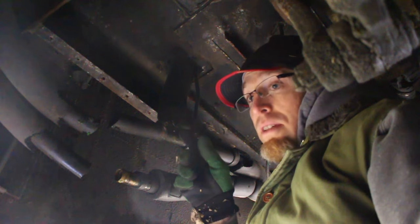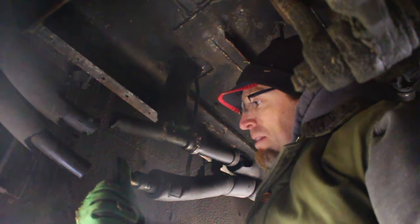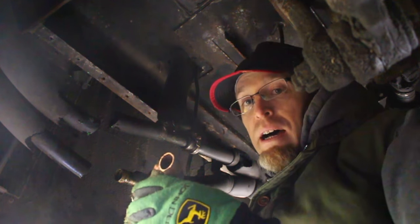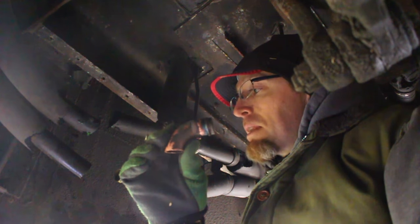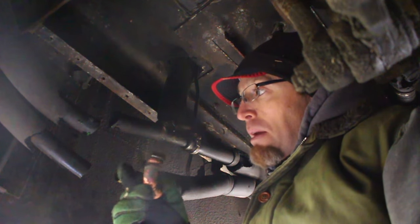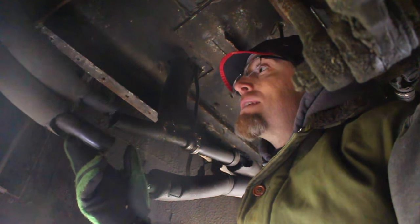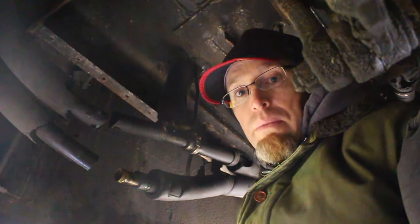This line comes from the engine, goes up to the defrost heaters, and then comes out this way. I've cut it, and this goes back to the engine. As you saw, I just pilfered some copper off one of those heaters that was back in the bus and I'm going to use this to make my loop. The lines over here are the ones that went back into the bus and I'm just going to pull these out in a minute and get rid of them.